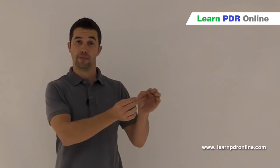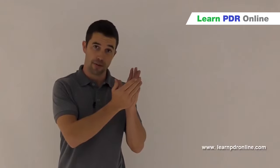When you get to a position where the dent is smaller and smaller and you've almost taken it out, get yourself a little closer and look at the angles — effectively zooming in so you have a real close look at those high spots and low spots. This is often missed, but particularly when moving around and checking from different sides, don't be afraid to get really up close to the dent to make sure you can really see what you're doing.